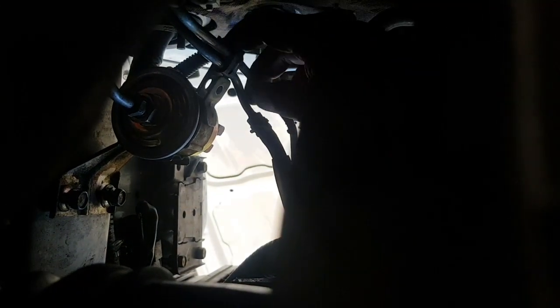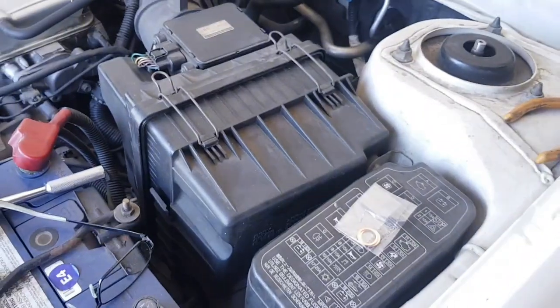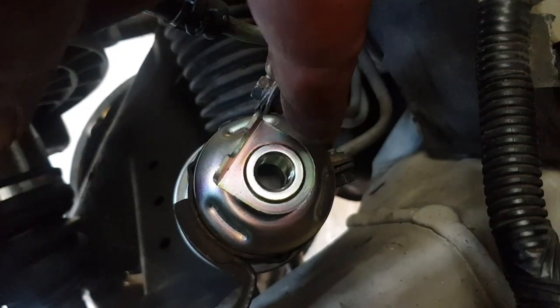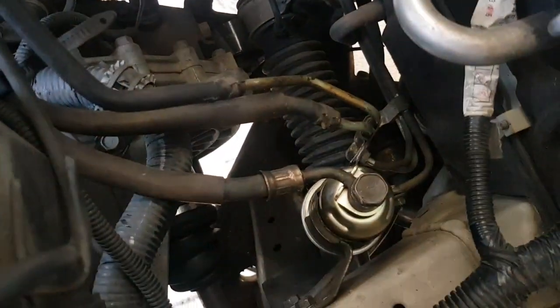Okay, so I've done it by hand — it's all the way up. Now I'll tighten the two bolts that mount it, bolt the lines back on, and then we'll work on the top. We've got everything mounted back in there — 10 mil bolt, the two 12 mils, all tight. The hose underneath is done up finger tight. I'll put the 19 mil spanner back on just under this bracket and tighten the 14 mil first, then we'll work on the top. They've given us two new washers with the filter — that's a beauty.